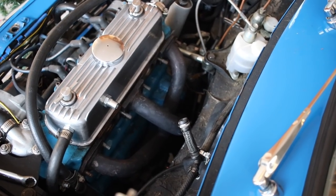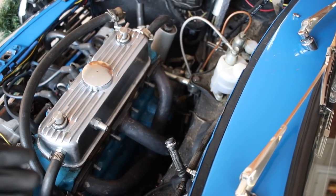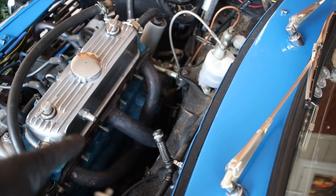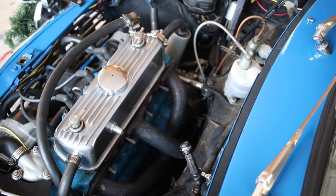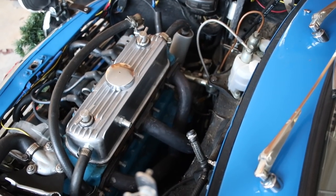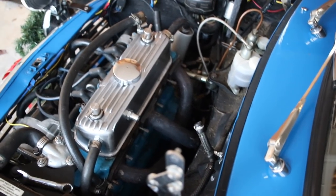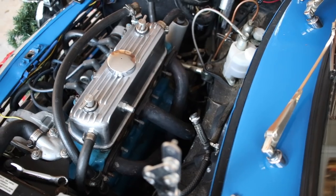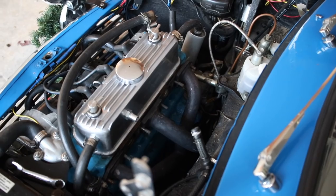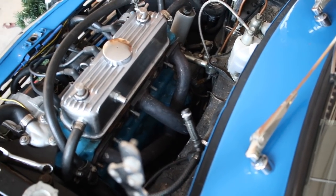Now I've got a good look down into the back of the motor and I'm going to disassemble the exhaust system by taking the piece that connects from the bottom of the header all the way back to the rear of the car, disconnecting it, dropping the exhaust, and then getting the header out. I've got another video on replacing the exhaust system from the bottom of the header back — there should be a link in the corner — but I'll skip ahead to the exhaust manifold being removed.